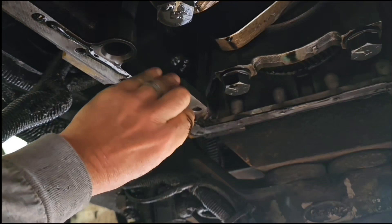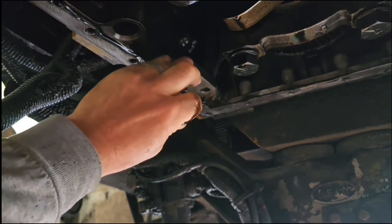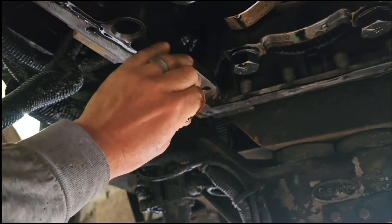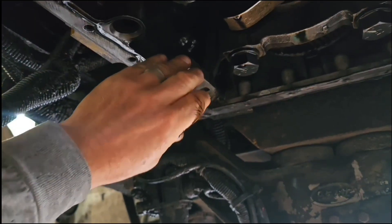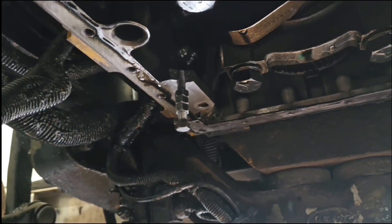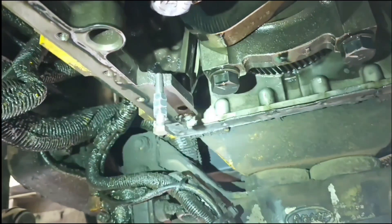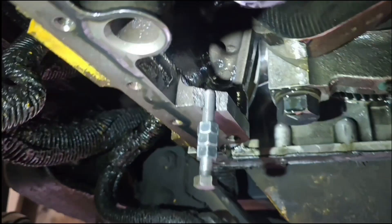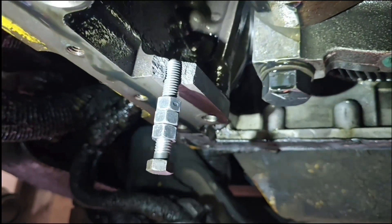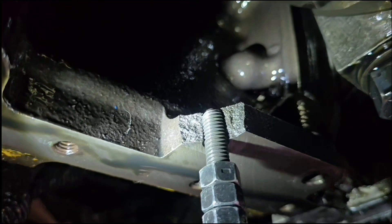We're taking this bolt and we're going to turn it into a stud. We've got about a half a thread there that we can kind of thread into. That way we know it's in the right place and it's going to be fairly straight, and it needs to be threaded in there at least the thickness of that little block that the oil pump bolts to. I'm just going to weld that baby in there with the nickel rod, then cut the head off the bolt. Those three nuts will protect the threads during welding, and once I cut the head off and back those nuts off, that'll thread-chase the end of it and have this bolt turned into a stud. Next thing we're going to have to do is get the hood on and get in position to get some welding done.